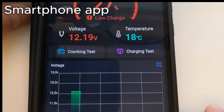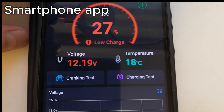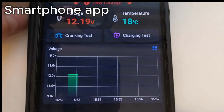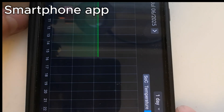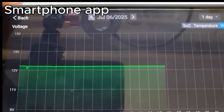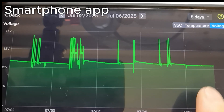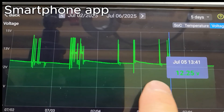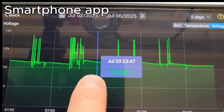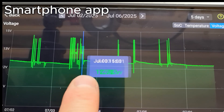The app lets you monitor the battery's condition in real time. If the battery has sat overnight and the voltage is below 12.0 volts, it's empty or nearly empty. If charging or driving doesn't bring the voltage up, the battery should be replaced as soon as possible. A fully charged standard lead-acid battery should show about 12.6 volts; an AGM battery, 12.8 volts.